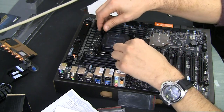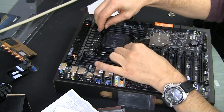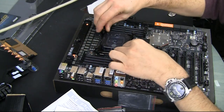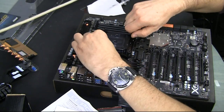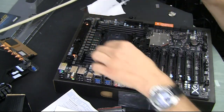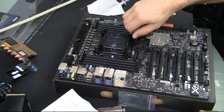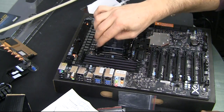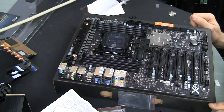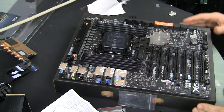Now that everything is in place, I start feeling the tension. We want to screw the posts in a cross manner. The posts are not supposed to level up — when they do, that's basically when you want to stop. A little bit here, a little bit there, going around each one evenly. That's pretty much it. As you can see, installation of a water block is one of the simplest operations you can go through in a water cooling project.